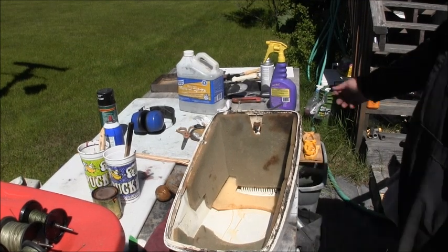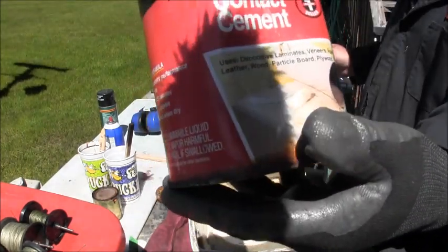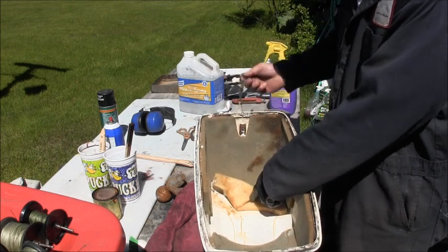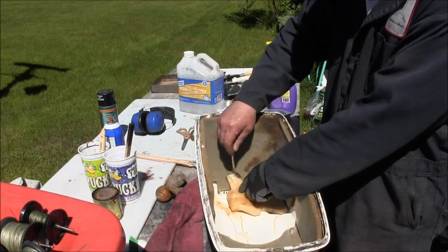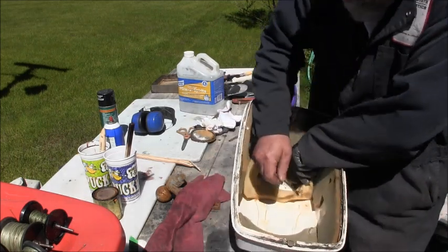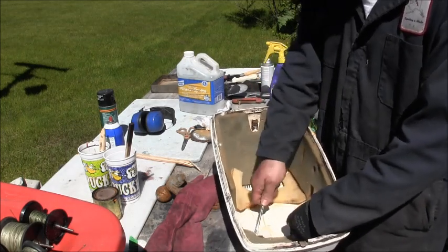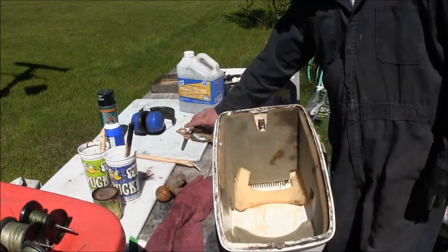Okay, you remember the bonnet. She had some loose. What I like to do is take some of this contact cement and put it on the actual bonnet itself and on the foam. Don't have to be a lot, just wipe some on there and then let that set up for a few minutes. Look, there's still crud under there, but it'll be glued down. There's a little there. Yeah, just put it on the foam and on the hood, glue that down with the contact cement,